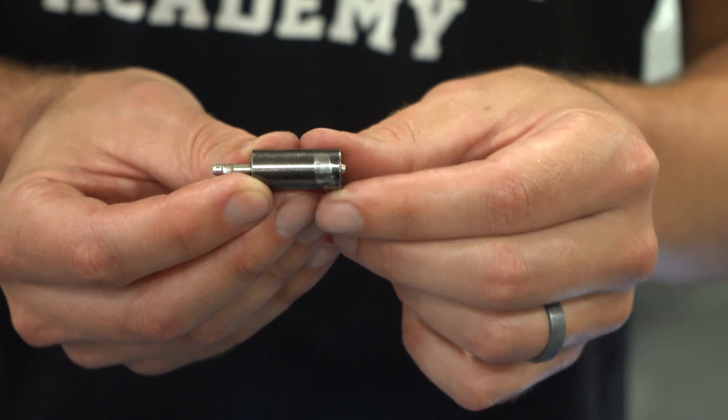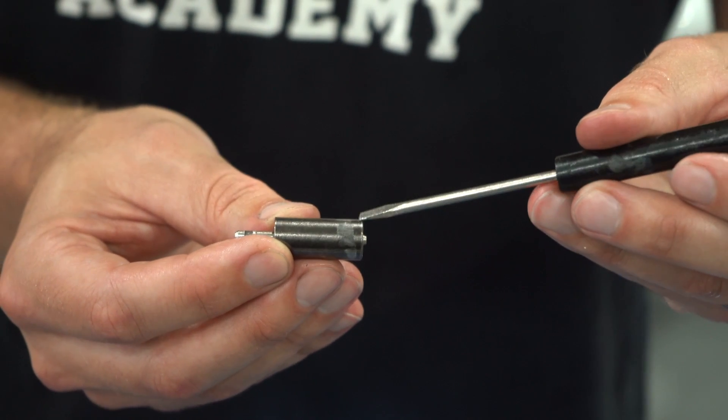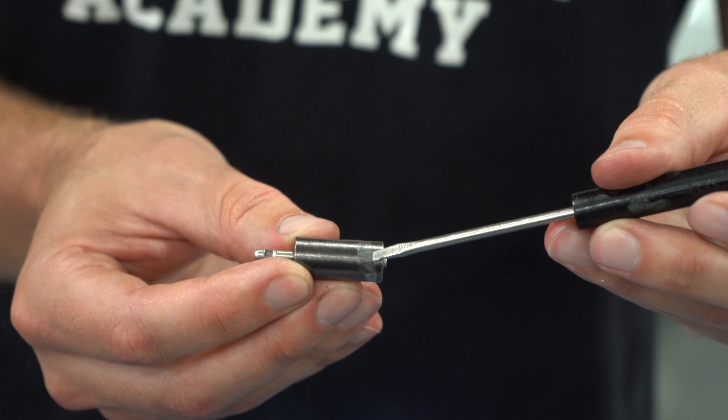Now I know how the regulator works — it's not rocket science. Why is my truck surging? The interesting thing that happens over the life of your truck is that there are a lot of fuel pressure adjustments. The load changes frequently — anytime the RPM changes, anytime you hit the throttle, the position of this pintle moves. It's going to move a lot at low load because generally you're operating at low load. So what happens is this pintle gets wear on it over time. If you look closely at the bottom of the pintle, you'll see wear marks. The more they wear, the more they don't move nicely, and when things don't move nicely, you don't get good granular control.